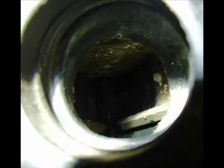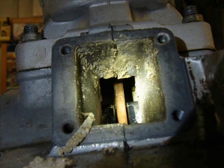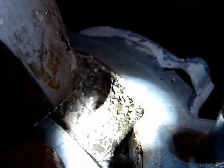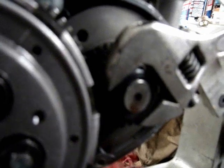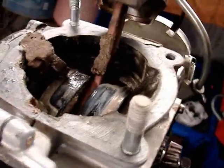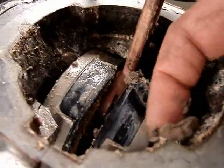There's a lot of dirt ingestion visible in the intake track in the reed cage — mud, not a good sign to find in there. Looking in there, not very pretty. This engine sadly has been sucking dirt for quite some time; pretty good evidence of that. A few additional pictures here of what appears to be mud. She's locked up tight. I was able to finally turn the engine over using a half-inch breaker bar, and it brought this mud up from the bottom end — it's been standing full of mud. I was able to get it to turn over, as you can see here.